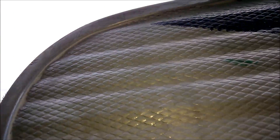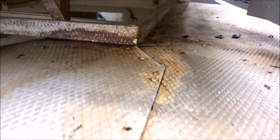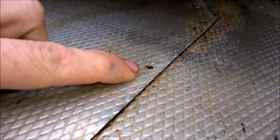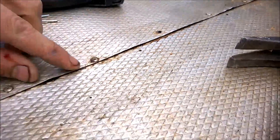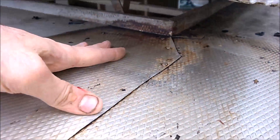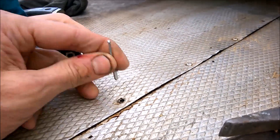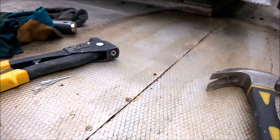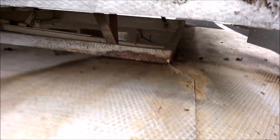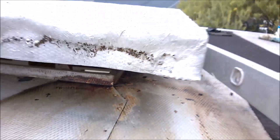The J rail is now in, looking much neater than it was this morning. I've added additional sealant there just to make sure it's all nicely capped off. The hatch is something we're going to do next - not today but next. We've got one pop rivet missing there, another one missing here, and quite a lot of gaps, so there's no doubt in my mind that's where the leak has been occurring. I just need to drill those out and pop rivet that in. We're going to take the pop rivets out, reseal, and put them back in.